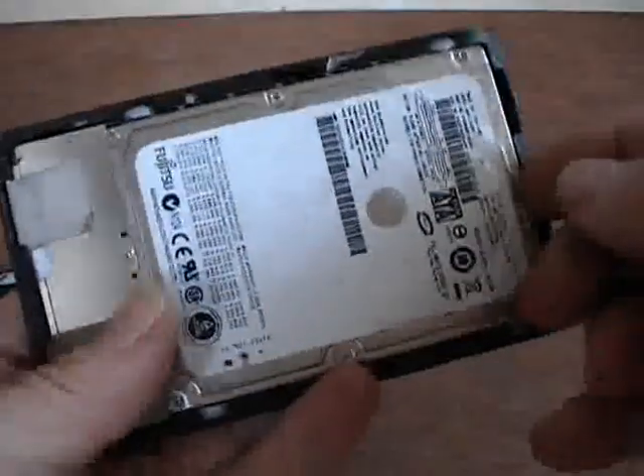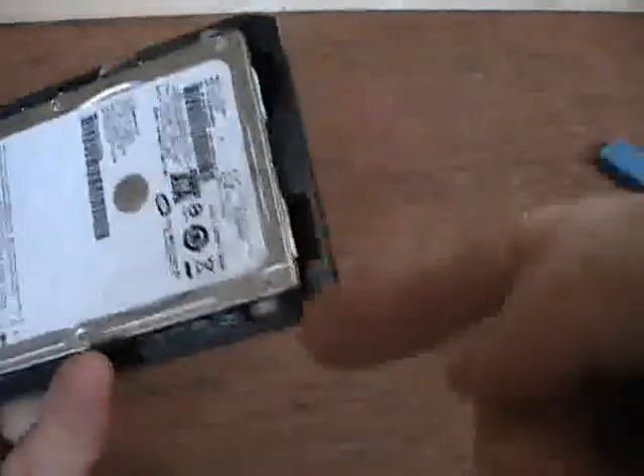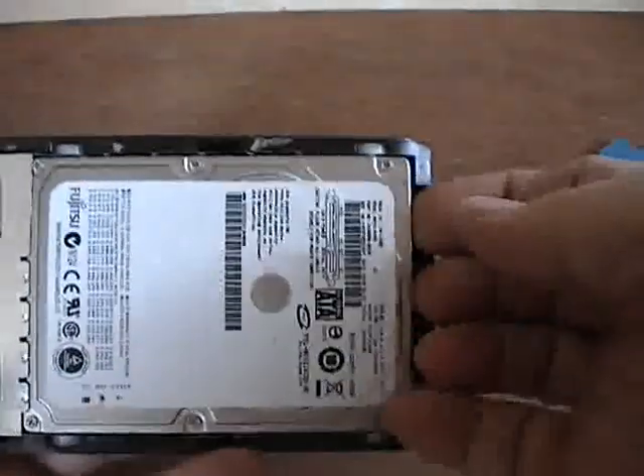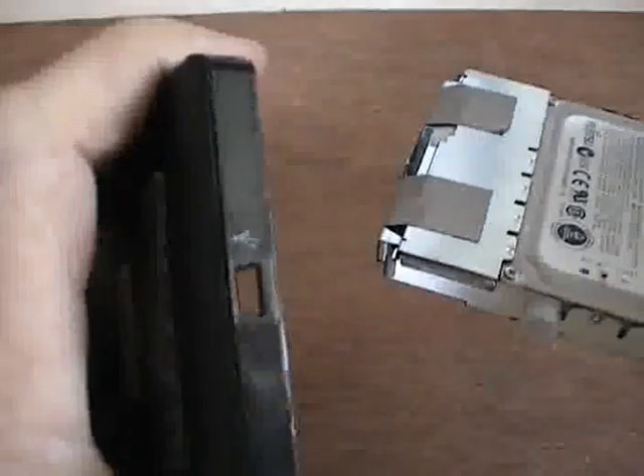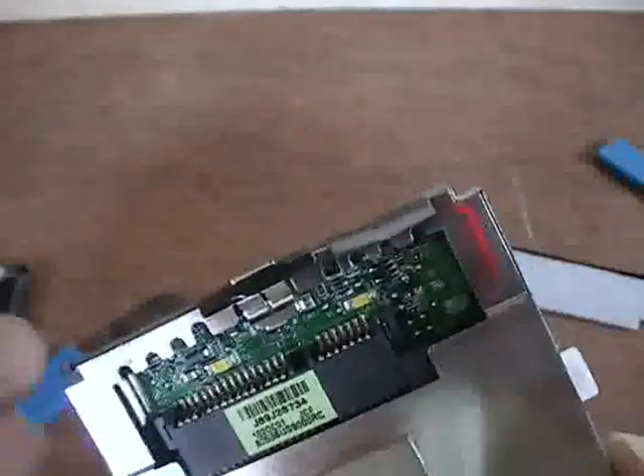When removing the drive, do not pull on the edge where the USB port goes in — you will break something. You must pull down here; there are two little tabs. Pull down here just with your finger and gently use your fingernail to pry up, and you'll notice that the little corners start to come up. Once you've got a little bit of an angle, then you pull away from the hole in the case for the USB fitting — pulling away because this fitting projects quite a bit beyond the flush surface of the case, and if you pull straight up you would damage this very delicate apparatus inside the controller for the disk.